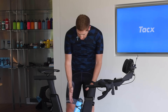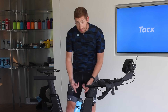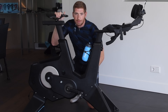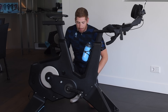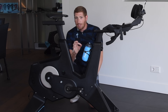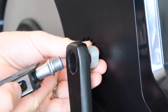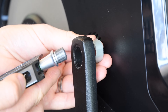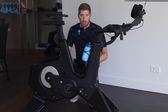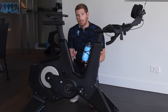Water bottle holder — obviously super important — so that's there. And this is where it gets really interesting: down here are the crank arms. Now these aren't just normal crank arms — they have three settings for three different crank lengths: 170, 172.5, and 175mm. You have a little pod thing, you pop it out, put whatever pod size you want in there, flip it around, and it changes automatically. The crank itself doesn't technically change, but the effective crank length does. This is something we've seen with a couple of other companies, and it's really cool to see on this bike.